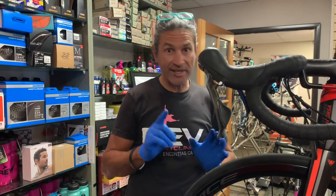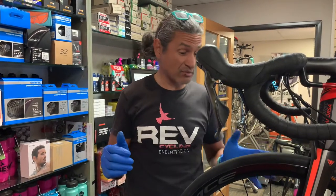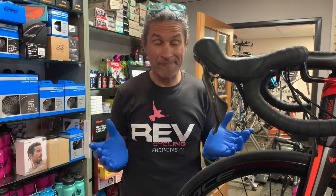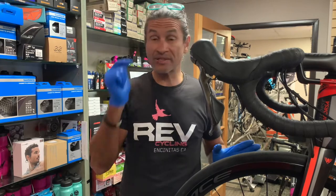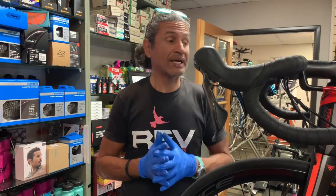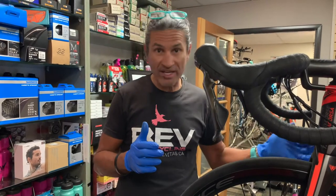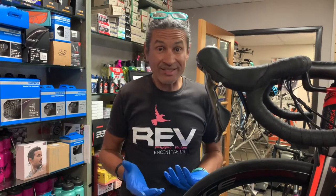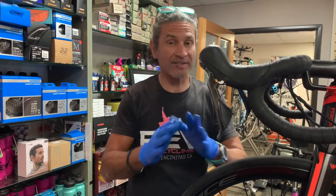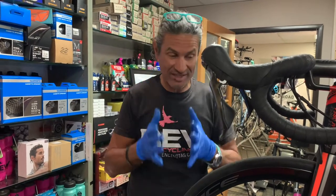If you start to get some noise, there are tons of videos talking about using acetone, alcohol, or disc brake cleaner. I need to be honest with you — a lot of these hacks just don't work. Just throw everything away: new pads, new rotor, and you will be happier. Do not spend a Friday night before a Saturday ride dealing with this. Here at the shop I tell customers: if I have to sand rotors and use all these brake cleaning materials and it still doesn't work, you'll pay for that labor time plus new rotors and new pads anyway. So just get new pads and new rotors from your local bike shop.